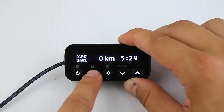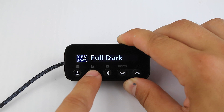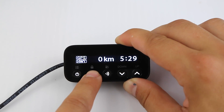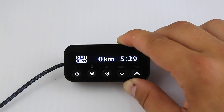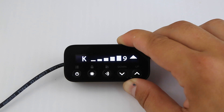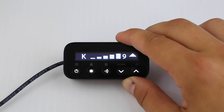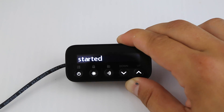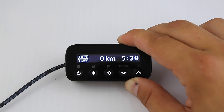Right here is going to be our brightness options. Now if we long press it, the button actually doesn't do anything. However, if we've got a K band alert going on — there's what that looks like. If we long press this, that'll actually go ahead and start the GPS lockout learning process, and now it's going to go ahead and learn this area as a lockout zone.